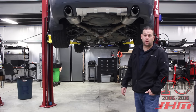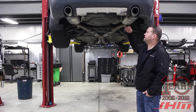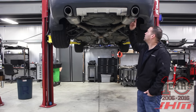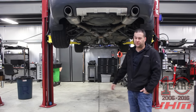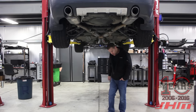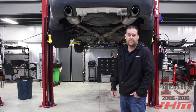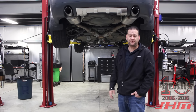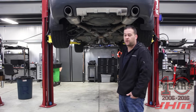Now I want to show the exhaust and how it works on this car. The Magnaflow 2.7T two-and-a-half-inch cat-back works regardless of what transmission you have. It's a low-production car so this is just the best bet — we cut the tips down and pulled them in since they originally stuck out too far. If you go all the way down you can see it bolts up to our B6 S4 down pipes with an adapter we made right here. On this car, since it didn't get headers, we're using our standard B6/B7 S4 down pipes from a manual transmission car. Headers would go the same way — you'd just need a small adapter to our down pipes to run this exhaust on a car with or without a supercharger, with or without an automatic transmission.